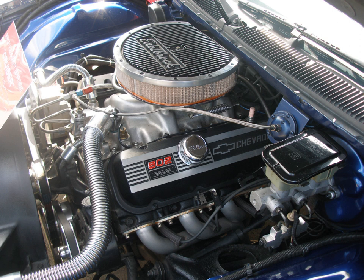The combustion chamber of the W Series engine was in the upper part of the cylinder, not the head, the head having only tiny recesses for the valves. This arrangement was achieved by combining a cylinder head deck that was not perpendicular to the bore with a crown piston, which was a novel concept in American production engines of the day. As the piston approached top dead center, the angle of the crown combined with that of the head deck to form a wedge-shaped combustion chamber with a pronounced quench area. The spark plugs were inserted vertically into the quench area, which helped to produce a rapidly moving flame front for more complete combustion.